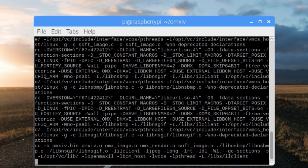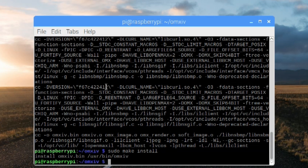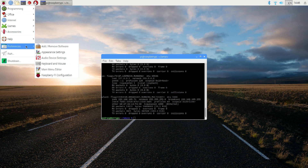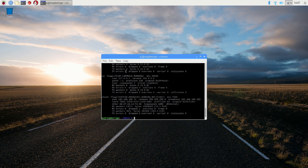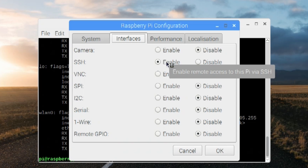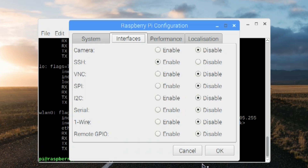You'll see the CPU pop up to like a hundred percent and then we're done. Next is sudo make install so it will install in the appropriate locations. Now that everything's installed, you are done — it basically just turned into a Chromecast. The next thing you need to know is just the IP address and also whether you have SSH enabled. To check that, run ifconfig to see the IP — for me it's ending in 71. Then pull up Preferences, go to Raspberry Pi Configuration, go over to Interfaces, and make sure that SSH is enabled.